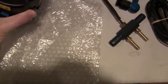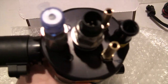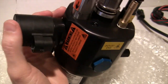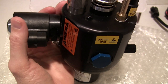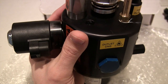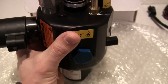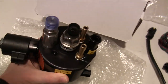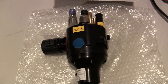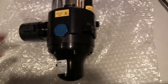As you can see it installs really, really easily. The solenoid is on the left — this is the high pressure solenoid, and this is the only part of the reducer that would require any maintenance, if at all. This is a maintenance-free reducer. A lot of other reducers out there you're going to have to get checked out every 20 or 30,000 miles — not with the HD, so just keep that in mind.